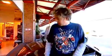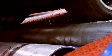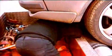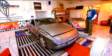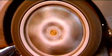This might look like a random industrial estate in the middle of Slough, but actually I'm outside a place that has a very clever and quite simple way of giving our car the performance it really deserves. This specialist tuning company boosts horsepower by reprogramming the engine management computer. It's safe for the engine and fast to do. Putting the car onto a rolling road means we can get our Porsche up to top speed in a controlled environment and measure the current horsepower of the car.